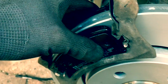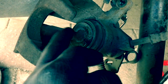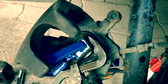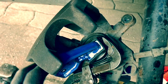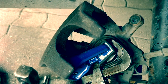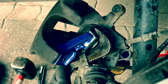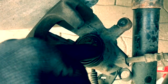The caliper piston gap is going to be too narrow because the pads were worn before, so I need to wind the piston back in — rotating it clockwise. There's a special tool for this which costs about 30 quid, but what I'm using is just a little G-clamp. You've got to press it in as you rotate it — I use my grips to turn while the clamp applies pressure from behind. That's now wound right back in. You press with the G-clamp and turn clockwise at the same time, and it'll go back into the casting.